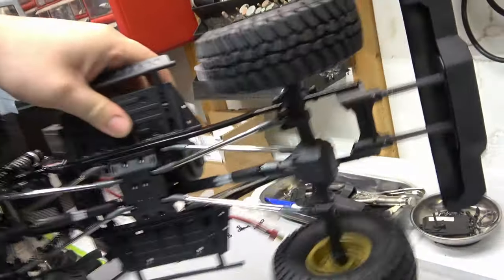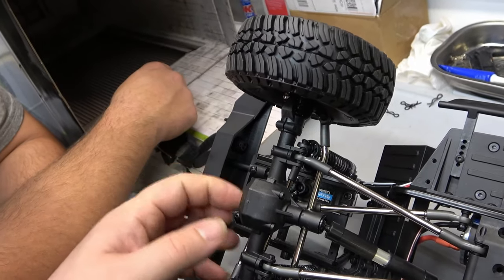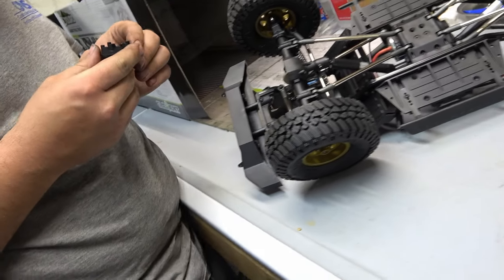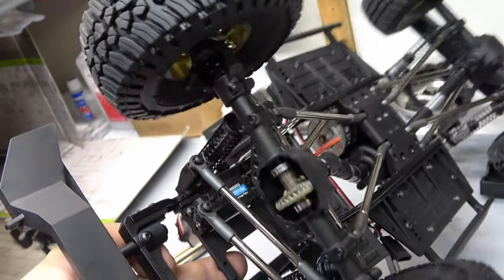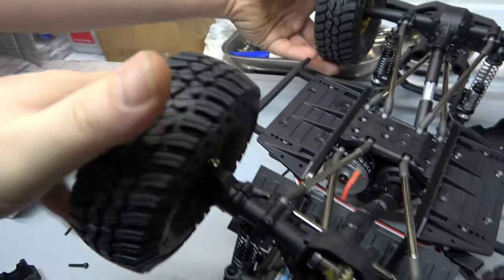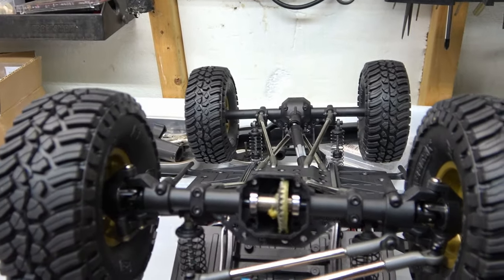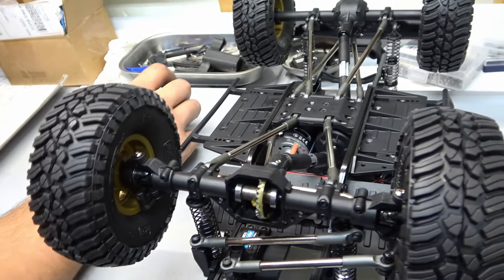I just want to kind of check how well the Element RC is built. I want to get inside there and see if they greased it up good — things like that. I'm just curious. This is a good tight fit, as you'd want it to be. Not a whole lot of grease in there, but it is smeared around — it is coated completely. Nice spiral cut gears in here. It does look pretty good. Look at the bearings — they aren't even shielded. Well, they're caged but they're not shielded — they're usually at least metal shielded. It's pretty decently greased though.